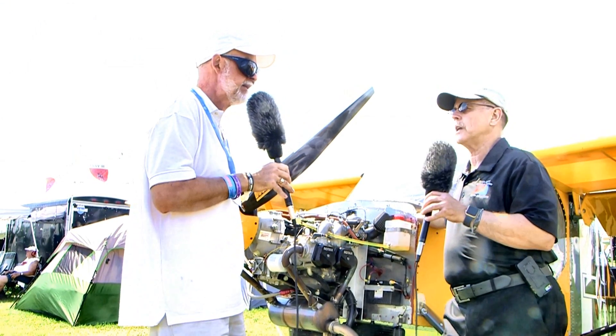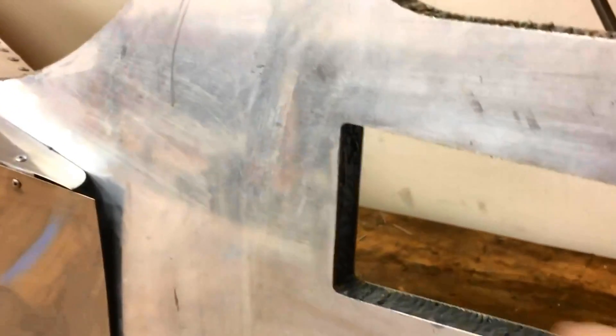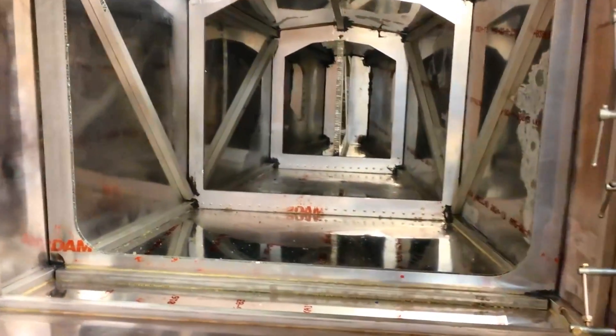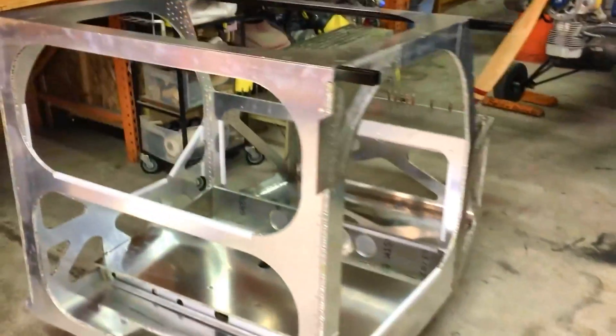The airplane is delivered as a kit. We've broken it into two parts: the airframe kit and a finishing kit. The airframe kit is everything you'd expect to make it look like an airframe. The finishing kit covers all the lift struts, control cables, and control items — not the fuel tanks or cowl, but everything else. What you need to add is engine, prop, instruments, glue, and paint. All nuts, bolts, hardware, and rivets to put it together are included; covering is not. Between the two it's a complete kit, traditionally firewall back.